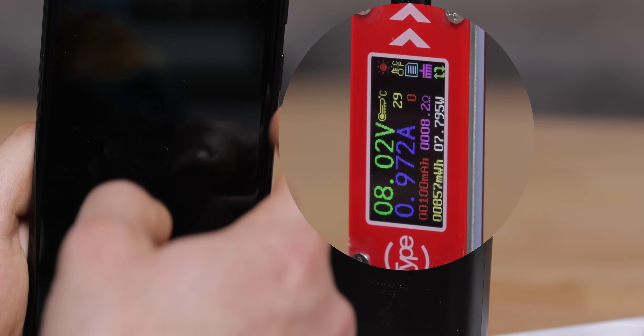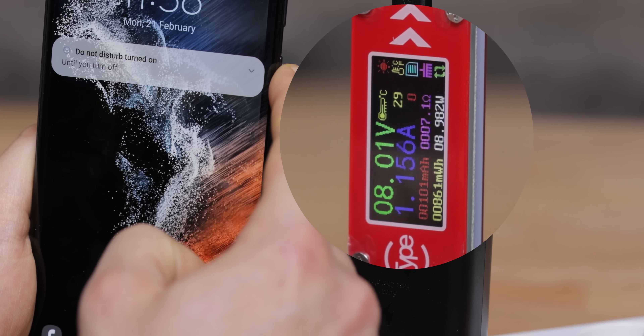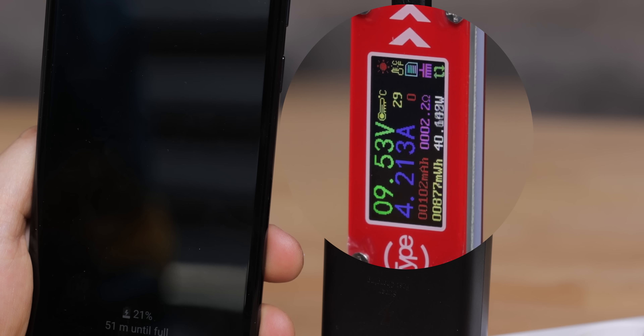If you run something more intense and then lock the phone, it takes a few minutes for the phone to cool off before it reaches back those maximum speeds. With the 45W charger on the S22 Ultra, we also found that around 25% charge, speeds drop further to only around 29W with no on-screen warning — it still says 'Super Fast Charging 2.0.' You need a specialized power meter to catch this behavior. The 25W charger, by contrast, maintained its full 25W output at that same point.